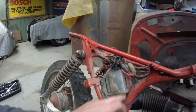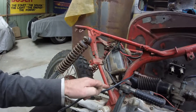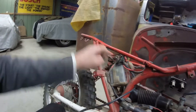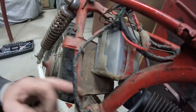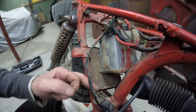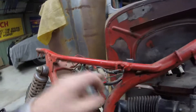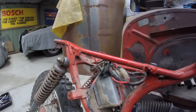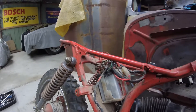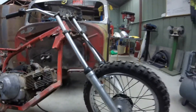I'm going to make up a nice little proper enclosed tray here, probably from about this point down to here and then up to here. I'll make a V-type piece of plate similar to what I've got here - this was cut out of the old CT110 posty bike. I'll fully enclose it so all the wiring, condenser, fuses, and whatever else is there is pretty much all encased, protected from mud and water flicking up from the back wheel.